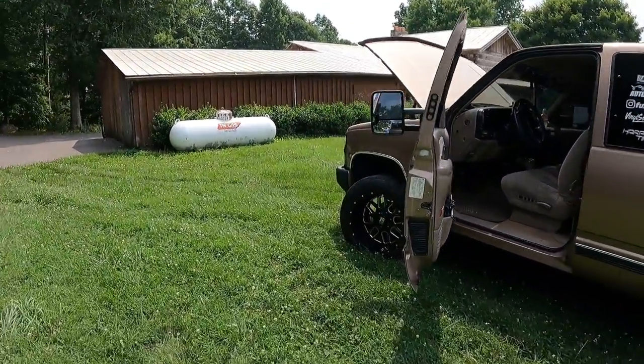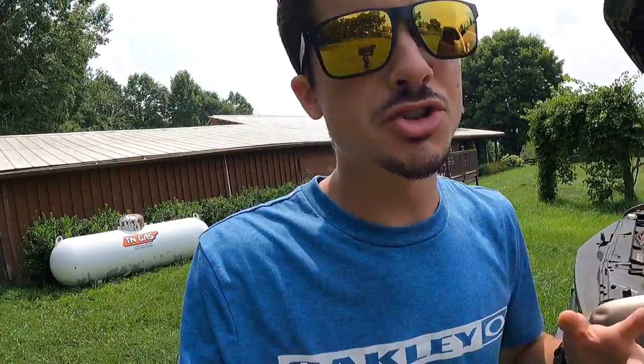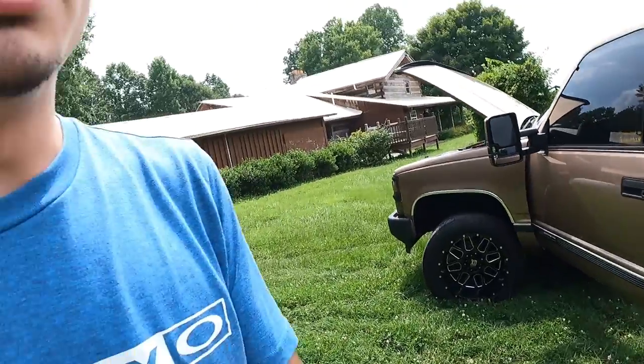The truck stops more consistently — you don't feel like you have to keep smashing on the brakes or worry about brake fade. The brake booster is about $100 and I highly, highly recommend it — you won't regret it. To install the rear brake kit yourself it's about four to five hours; a shop that's done one before will take about three to four hours. The front is just a standard rotor and pad swap, then you break them in following the instructions supplied. This is not a sponsored video — I just highly recommend R1 Customs and LS MFG.